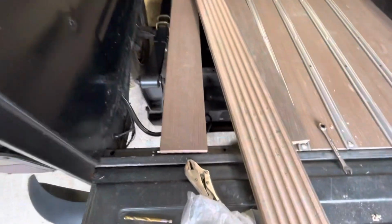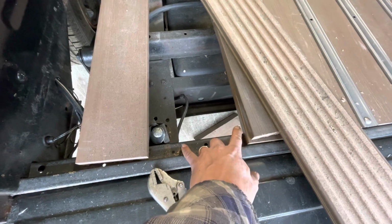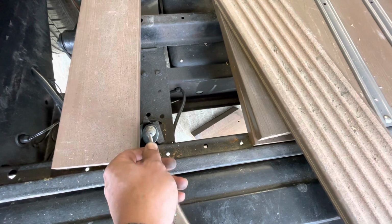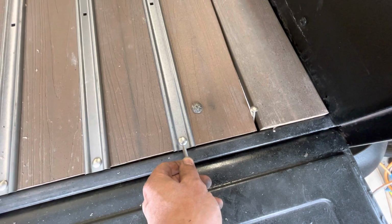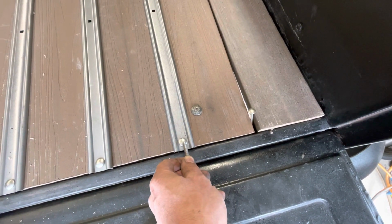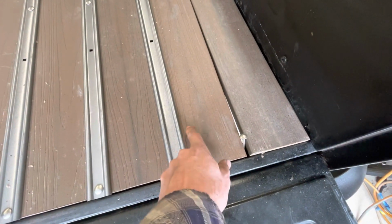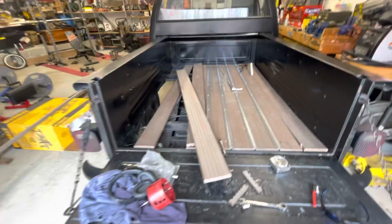If you guys asked me how I did this, I measured. I have a pretty good eye with measuring things, but make sure you bring your board in with the correct gap and measure off of your bolt. So what I did was I took a bolt and I measured from my center line, and I measured from here to get this hole drilled here. So make sure what you're measuring off of. This bolt was just resting here, and I measured in, and then I measured up. But if you don't account for your gap, whatever this is, 1/4 inch, you're going to end up missing your hole, and you're going to have to wallow it out, and it's going to be cheesy, man. People are going to say, man, you should just give it up.